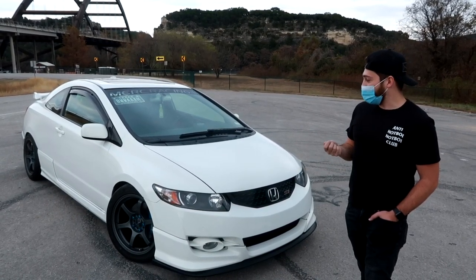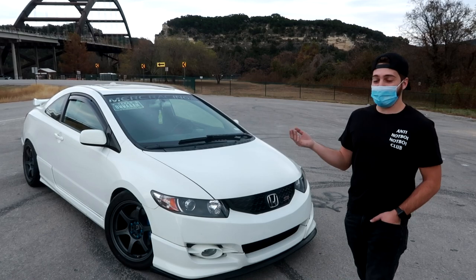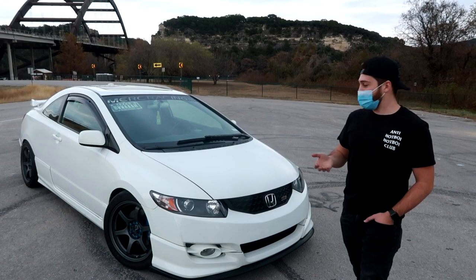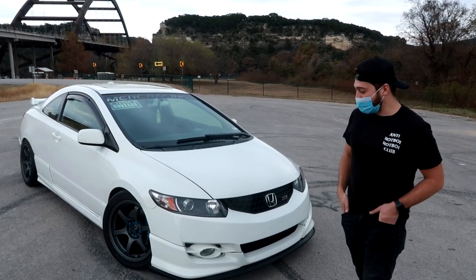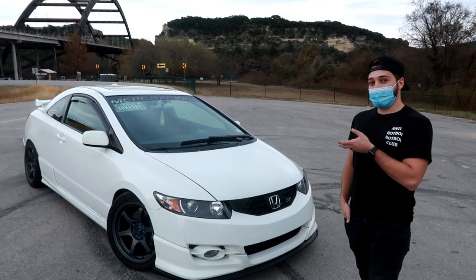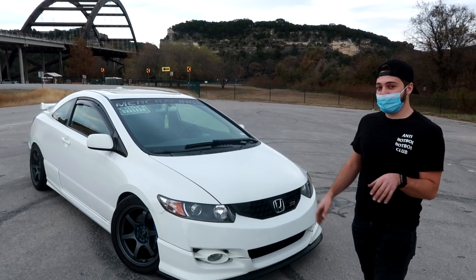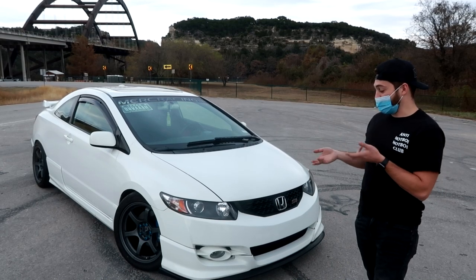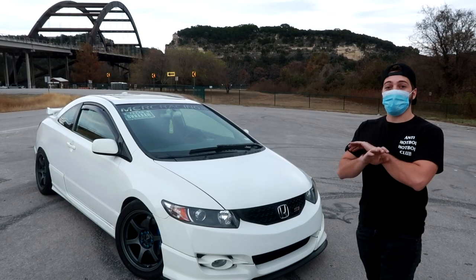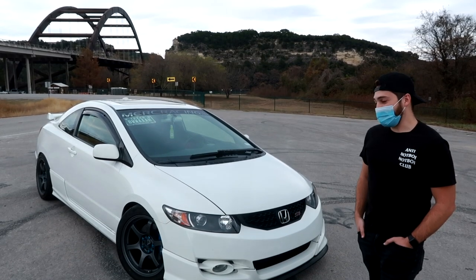I sold the CT kit and got everything together. Long story short, I killed the supercharger. I had it set up for boost-by-gear but hadn't hooked up any gauges. While burping the car after the first start, I'd flipped the hoses for boost-by-gear backwards, so at idle there was no airflow through the blower. It took five minutes — I overheated it. When I pulled the blower, the rotors were destroyed. They wouldn't warranty it because it was my fault.